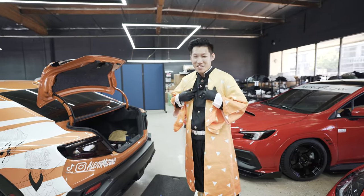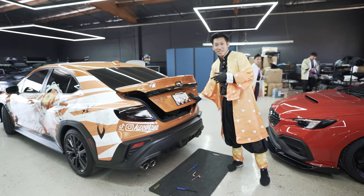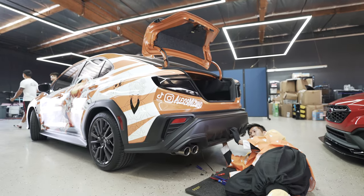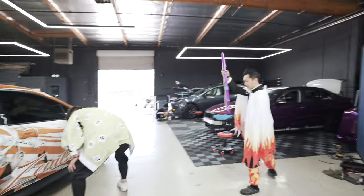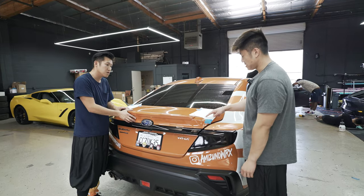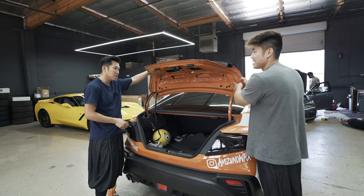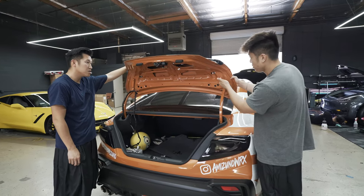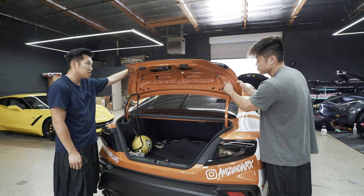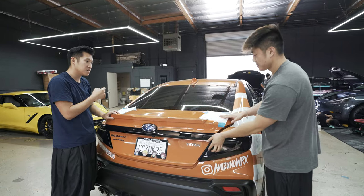Back at you again from Elite Wraps. This is Kevin. I'm here to install the third brake light today and an STI spoiler for this trunk. Kevin already prepped all the holes except for the fourth hole, which is right behind the trunk hinge. The fourth bolt has to be installed behind here on the side, because this is the strongest part of the trunk. We made the specific hole design to be here so when you install it, this wing ain't going anywhere.